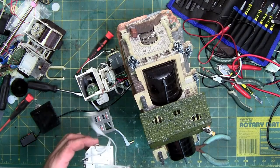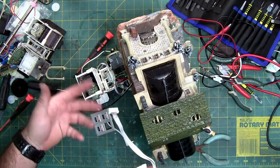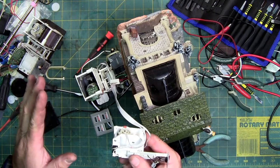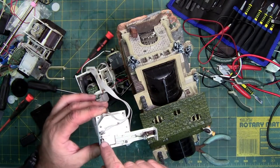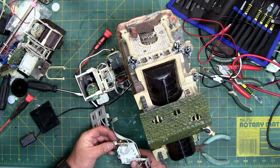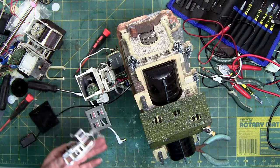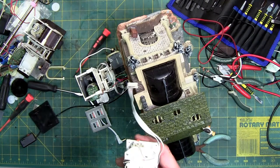Get the drawer out — it doesn't matter how you do it, except do not pull it. If you can't get the drawer out with the circuit board, turn the power off or unplug it from the house, then run 4.5 volts to the two connections on the back of the motor. You can run 3 volts if you want to make it slower so you don't break it — and don't reverse the polarity, because if you do and it's already in, it'll just try to pull it in more since you're bypassing the safety switches. You can use this plug and touch one side, then run something from the plug over to the other contact, and flip it over if it's going the wrong direction. Worst case, if the circuit board is bad, use it as a static prop — these circuit boards don't have spare parts, especially if the blob chip or sound chip fries.